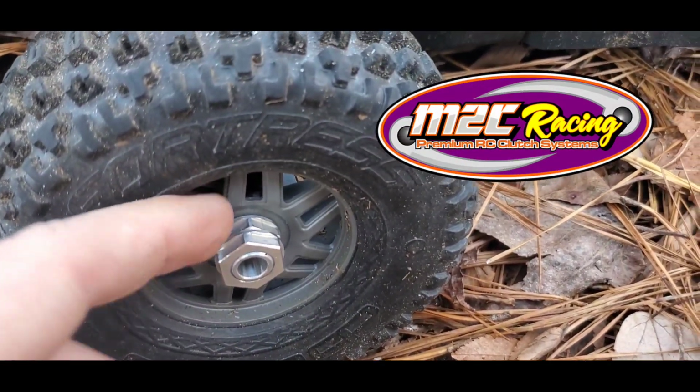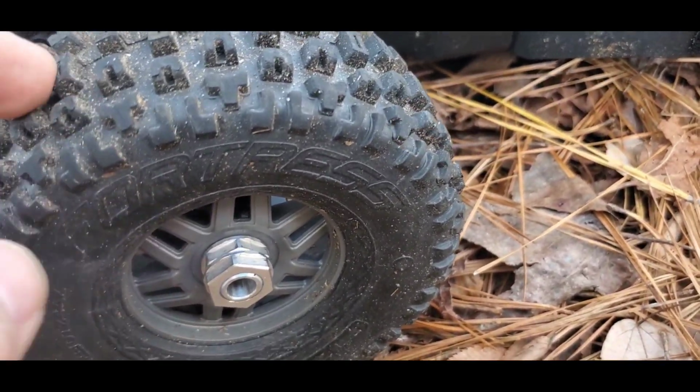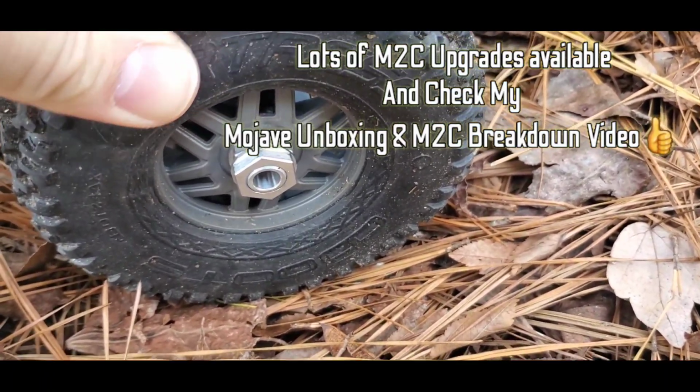Now these add 2 millimeter to the hub. They push it out a little bit further so they don't rub on the inside and potentially strip out the plastic. If you've seen guys with tires flying in videos off of these things, that's why. This is going to help it out a little bit more than even with the EXB. With the EXB, they added 1 millimeter. This adds 2 millimeter. Really eliminates the problem.